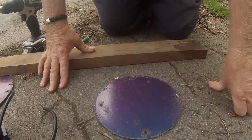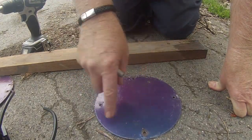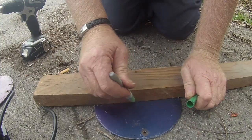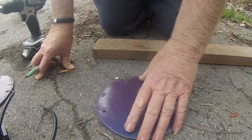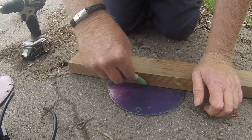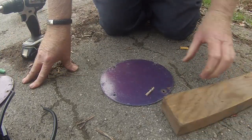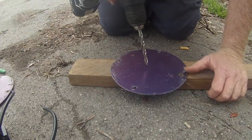Because I'm mounting on this panel, I need to find the center. Luckily I've got four holes. I marked which the top hole was so that when I put this back in, these holes will line up with the screw holes and I'll have the light facing in the right direction. So just mark the center and then drill a hole the right size for the bolt.